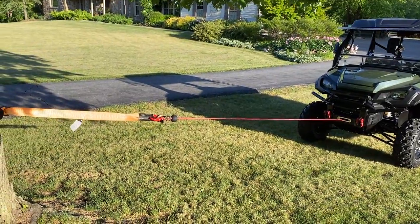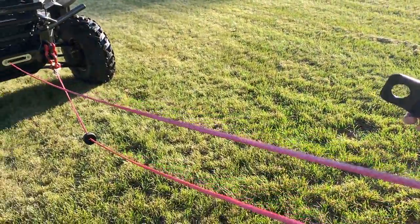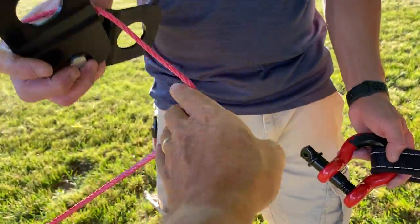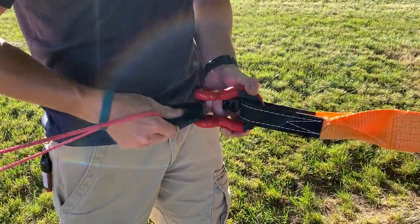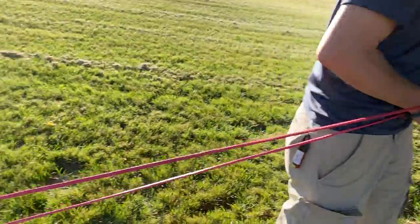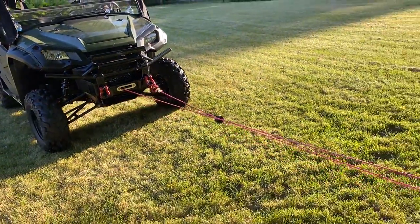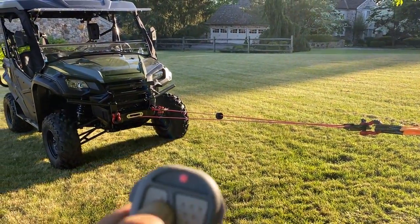It's a beautiful thing. Now let's demo the double line connection. The double line pull is where you take the winch line and bring it back to itself through the snatch block — there's a pulley in there. You just loop the winch line through the snatch block. The two holes in the snatch block go through the pin of the shackle that's already around the tree saver. Here we have our clevis hook connected to a couple of shackles. Theoretically, the double line pull gives you twice the load capacity. Wahoo!